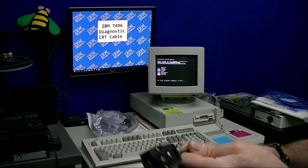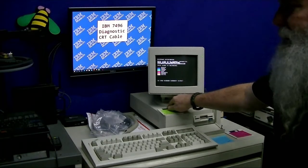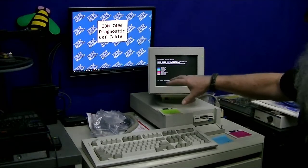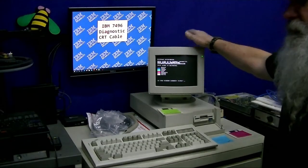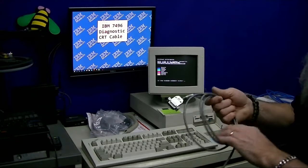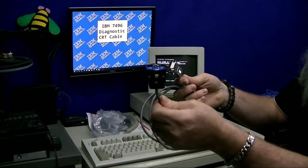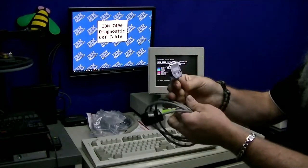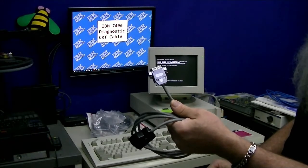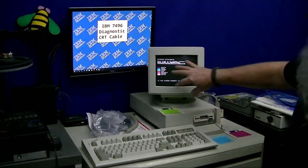I'm just looking for a way that doesn't have to go through how the monitor is attached to the case. You've got this big old kludge in taking this apart, for the purposes of if somebody was testing the monitor separately. The way I'm going to have it set up is just plug this cable in the back of that monitor, plug this into the suitable testing video output, maximum 640 by 480 resolution, or what MCGA or VGA could produce for this small screen.